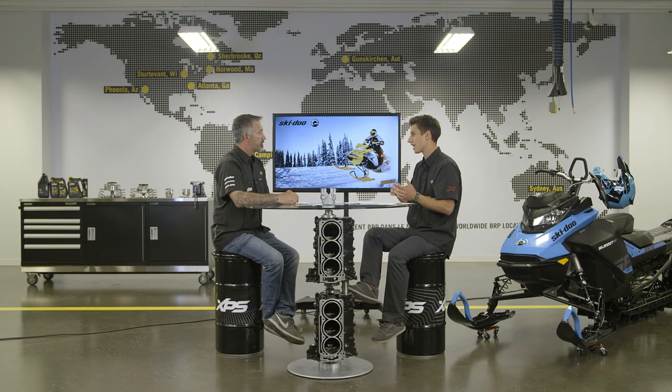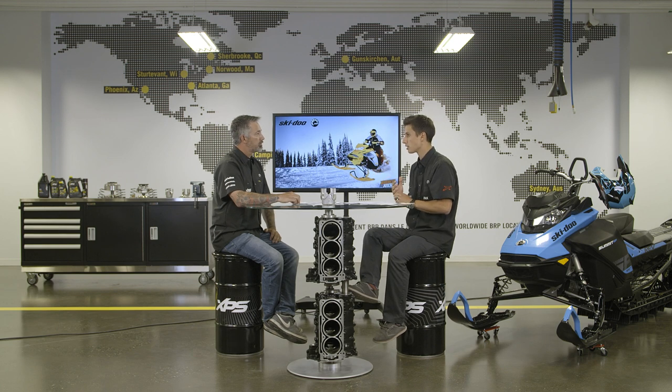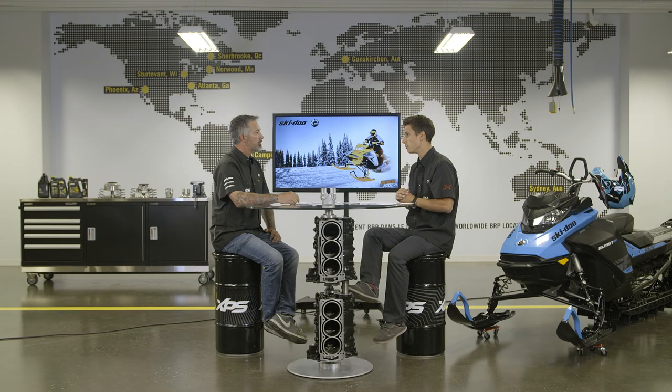What we're trying to do is find the perfect recipe. Calibrating the QRS or the entire CVT is always a combination — or a compromise — between belt clampage, belt slippage, belt tension, and the heat generated in the belt by all those factors. We have to find a good recipe for our type of riding.